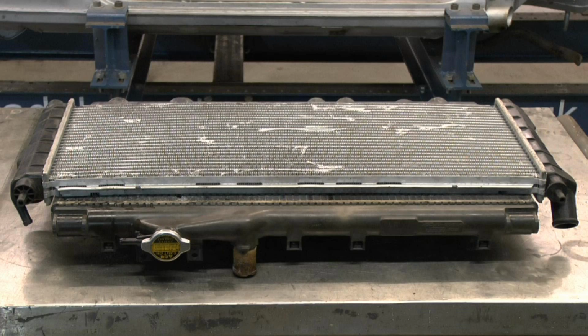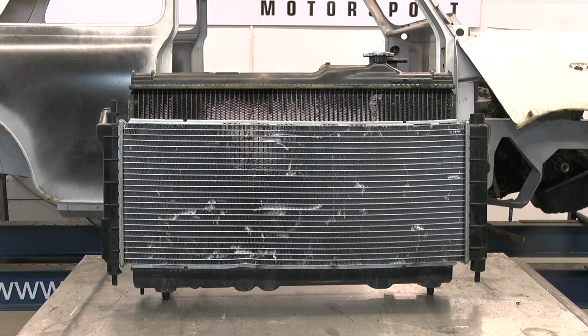Why a Corsa radiator? Well, it's slightly wider than the Celica had, and the tanks are on the end, and that means they package together really nicely. The ST205 radiator has the tanks on the top and the bottom, and the Corsa rad has them on each side, so plumbing them shouldn't be too difficult, and together it's a fairly compact solution. So all I've got to do now then is try and fit them.